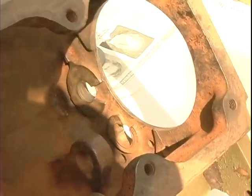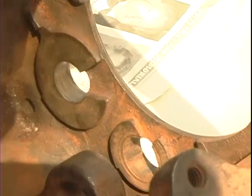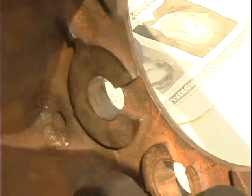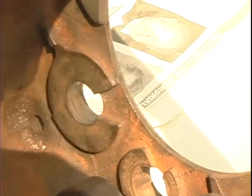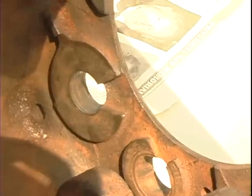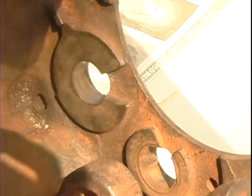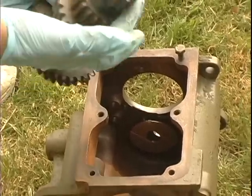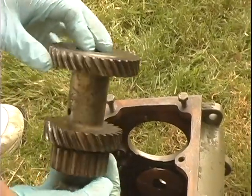The other side of the transmission has got another slot, and that's where the two other washers go. There's a slot on the back side of the transmission case that holds that washer from rotating around. The second washer goes in there and slides in once the cluster gear is kind of in place, with the brass side towards the metal washer — basically towards the outside. We have grease just holding all of these little components in, because without the grease things tend to fall out.